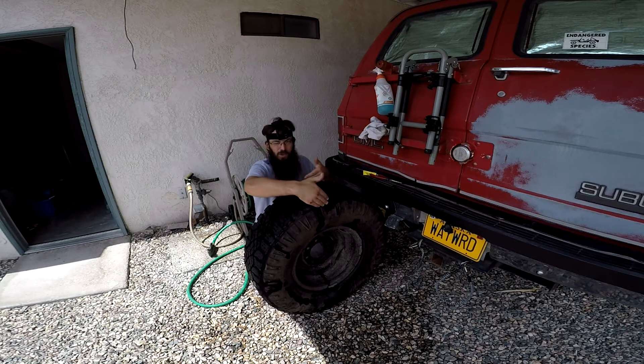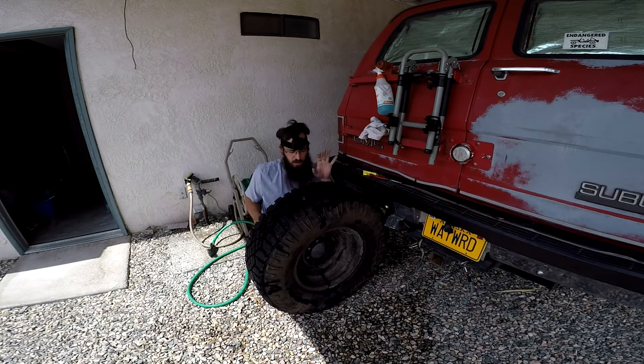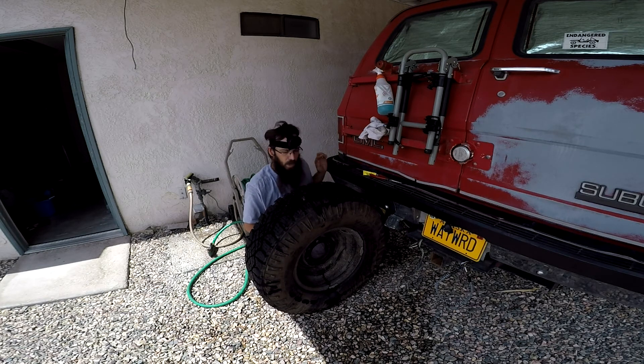If the plug is within the tread width I consider it safe and serviceable. If it's in the sidewall, I've done it to get off trail — especially with vehicles that don't have spares — and you can, especially when you keep the pressures low, like under 20 psi. This truck's street pressure is 65, it's a big one-ton truck. It's not recommended to do this — you should go to a tire shop and have them vulcanize a patch, which is like hot-iron gluing the rubber of your tire to a patch on the backside. That's the way to do it right and safe. But I've done this for years. Just make sure you trim off the tail once it's good and dry, run your air pressure, check it, keep an eye on it, and besides that you should be good to rock.